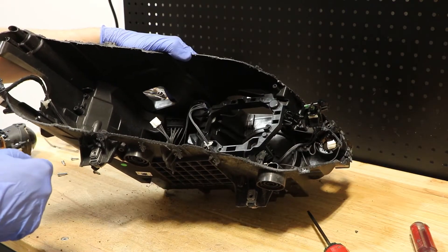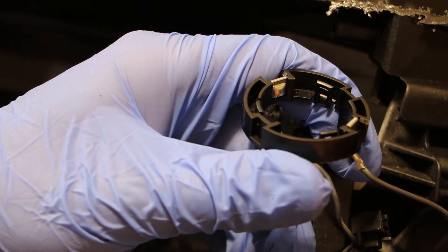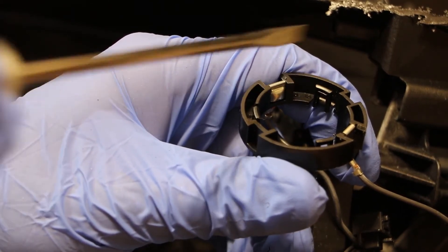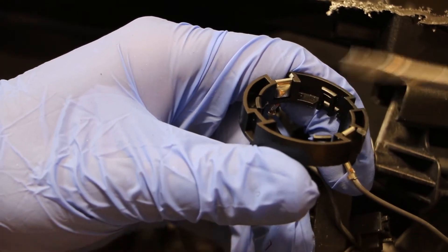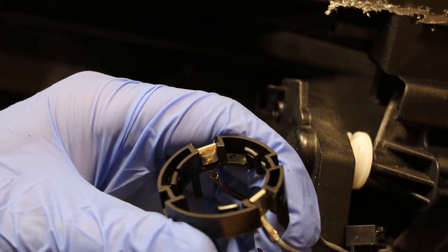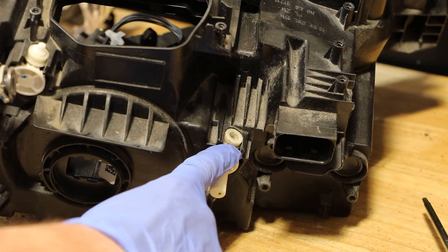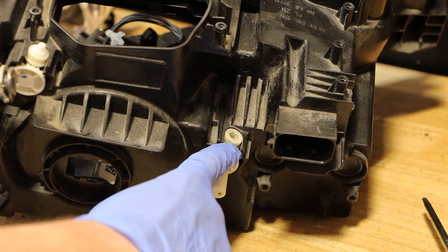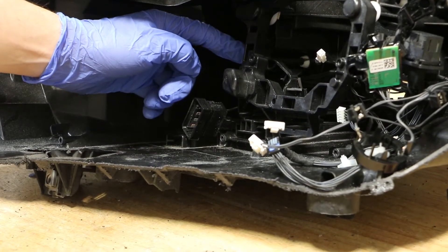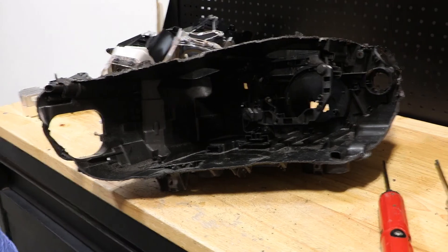At this point I can remove the wire harness from the headlight. In order to remove the turn signal bulb holder, there are three plastic clips that need to be released from the rear of the headlight — one, two, and three. You simply need to reach through with a flathead screwdriver and lift up on the clip, then pull the wire harness into the headlight and it will be released. In order to remove the rest of the wire harness, I had to move the AFS mounting bracket forward by using a 6mm hex key and turning this adjuster clockwise. With this AFS motor bracket out of the way, I'm now able to pull the wire harness free from the headlight.